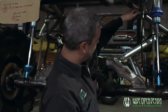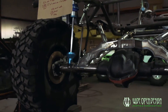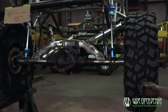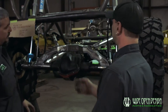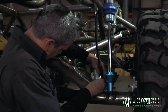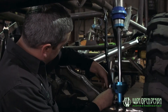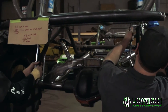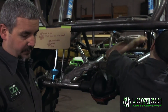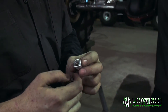So whenever you put the 17 inch strap on here, you can see that you can't quite reach it yet. But when we drop the axle down, we put the nuts and bolts there and tighten those up. We use a stover lock when we mount limit straps — just any kind of lock nut. A stover lock is a nut with little locks built in that locks the nut down. I like a stover lock better than a nylock because there's nothing to melt out.